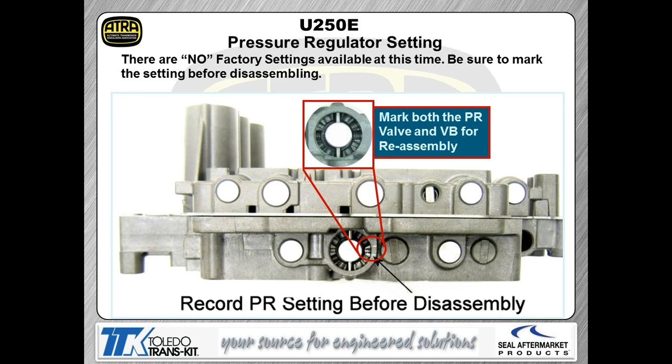The pressure regulator is adjustable just like it was in the 700 series Toyota transmissions. So again, nothing different than you've heard us talk about before. Make sure you mark the pressure regulator valve prior to pulling it out of the board so that you know you get it back in at exactly the same location. This would affect your baseline pressure, so you want to make sure that this thing goes back in where it's supposed to be.